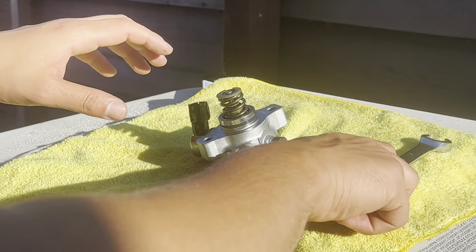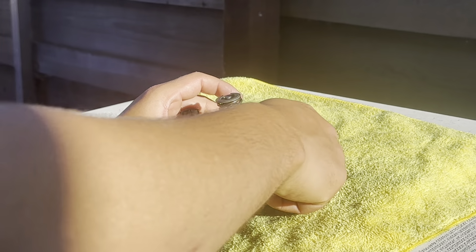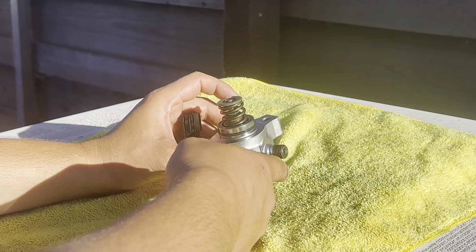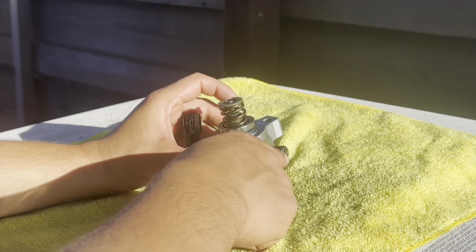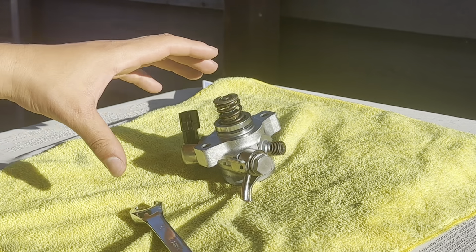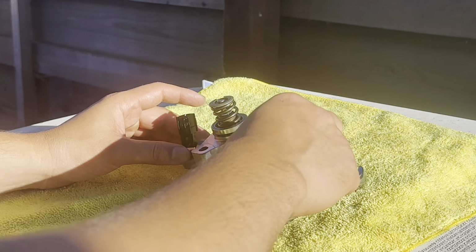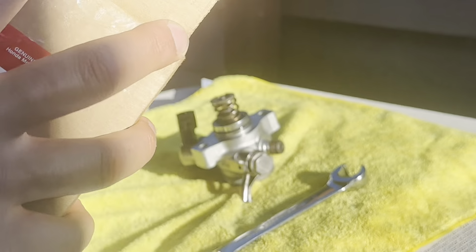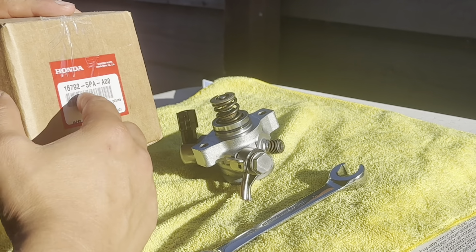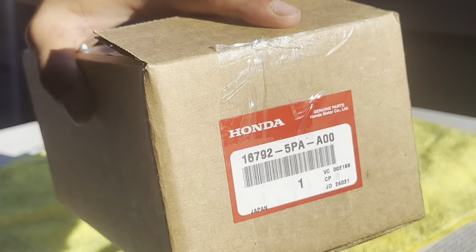All right, this is the fuel pump. It's a 17 millimeter. So turn this bolt right here, get it loose. I already loosened it, it's kinda tight. I recommend opening this inside the car and getting it loose a little bit, or if you have a press or something to hold this thing in place. So I got it open with 17 millimeter. Take this one off, and this is the feed line pipeline. We're gonna replace it with this. If you guys are looking for the part number, that's gonna be the number for it.